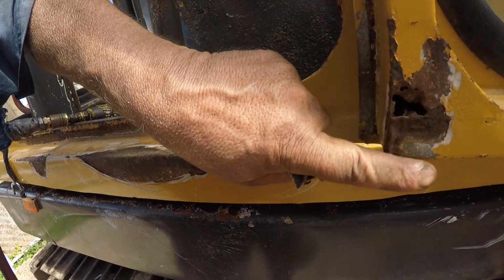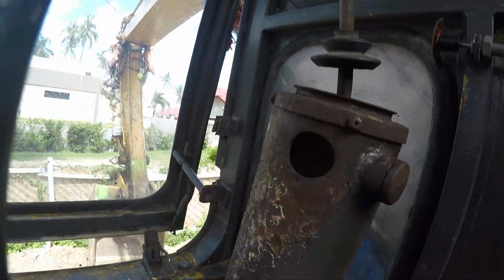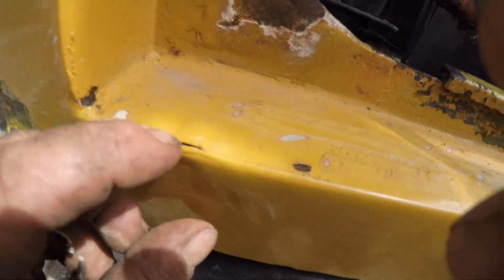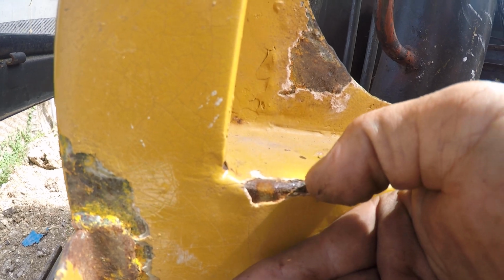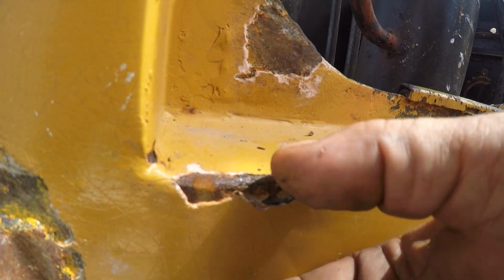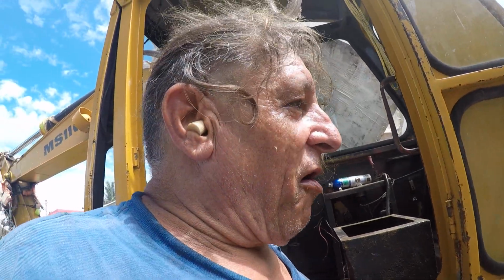They just fill this up with Bondo here, same thing. It's a standard operating procedure to just put Bondo over everything. I could show you 100 places. Here, this is one right here. Now this didn't rust after. You could see there's just no primer, no base for the Bondo itself. So automotive Bondo work itself is excellent, but they don't prepare the metal properly.